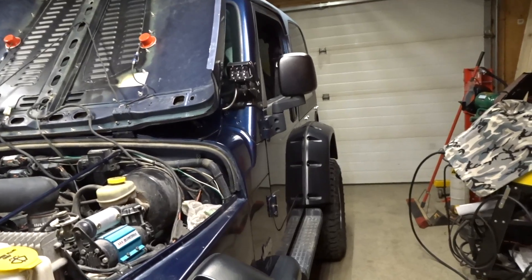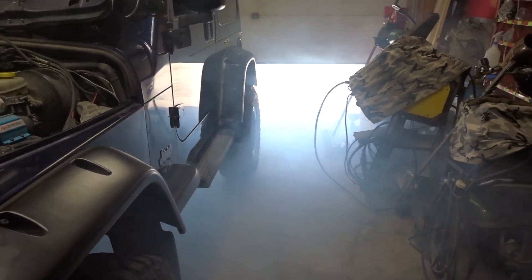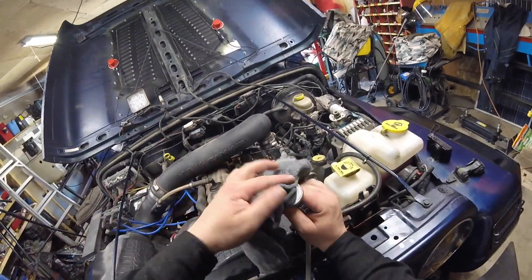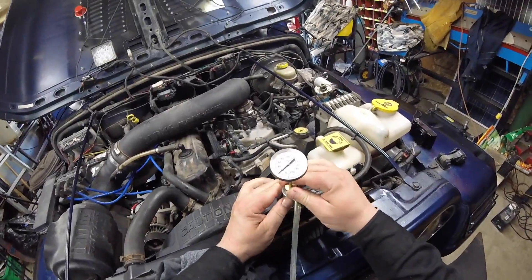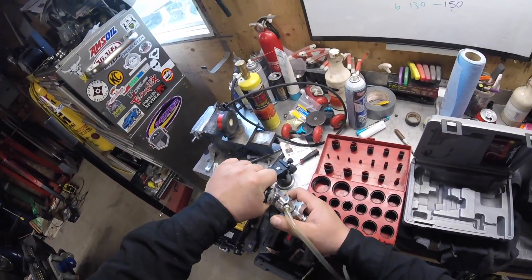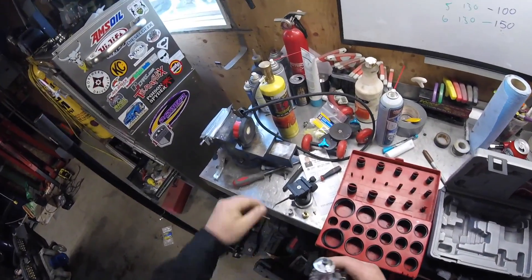I don't have smoke out of the exhaust yet — if the exhaust was smoking, that would be a telltale sign of a head gasket blowing. Put the tester in there and antifreeze pissed out all over. It's not exactly a perfect science because it leaks at the top. That didn't work out the way I wanted, so we're just gonna silicone and seal this thing up permanently.